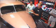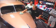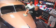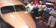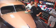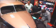Whenever you're wiping product off, fold your microfiber towel 4 ways. Help spread the pressure of your hand, use 8 sides to wipe with. Make little tiny circular overlapping wipes. Okay. You can actually tell it's a lot more clear there than the other place, a little bit hazy. Okay, so that's how you use a porter cable.